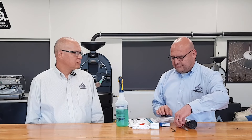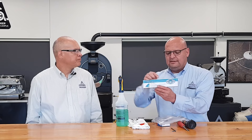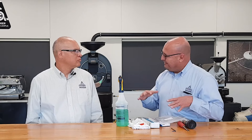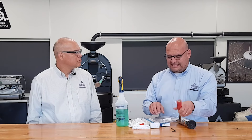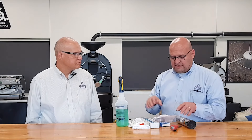For the front part, there's a cover that goes here. It's always a good idea to put food-grade silicone around before putting that cover. I'm showing this here because of the noise out there, but we're going to demonstrate live how it's done. You also need — this is a wood chisel, but you can use a paint scraper — because that cover that goes on here tends to seize up with heat. So you've got to give it a light tap for it to come loose.